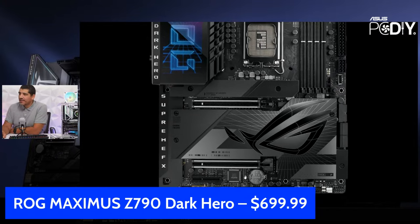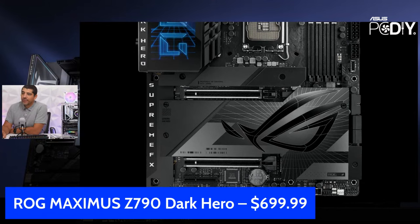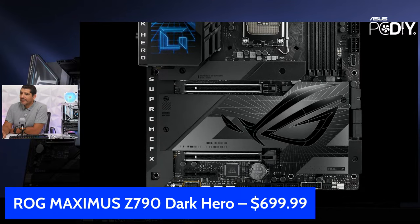You have subtle things also, like the PCIe alteration mode switch, which if you see this little switch right here, that's really optimally suited for debugging cases with riser cables. Sometimes you might run into a situation where you have a flaky or marginal riser cable, there's a different setting configuration and the system won't post or output correctly. So normally you literally have to disconnect the cable, go to your internal iGPU, then boot, make changes and then reboot. But now you can just toggle this from running in PCI Express Gen 4 mode to PCI Express Gen 3 mode so that it can actually output.